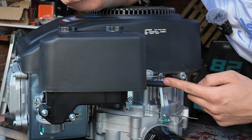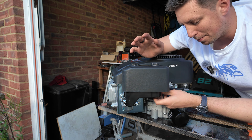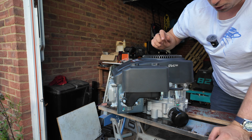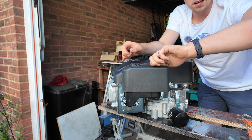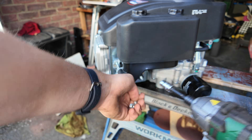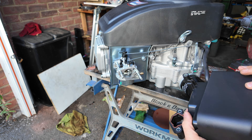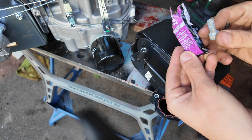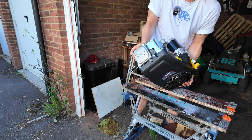The next thing is this oil breather. This breather goes into the air box - for normal use that's fine, but in performance cases you often get a lot more oil out of here through all the shock and wobbling, and you don't want that compromising your power. So we run these breathers just to the floor, which requires us to fill up the hole in the air intake so we don't get loads of dust past the filter. Two M6 bolts to take the air filter off, plus one longer screw at the back - this reveals the carb and the oil breather hole we need to fill. I'm going to use some gasket sealer and a bolt to fill it up.